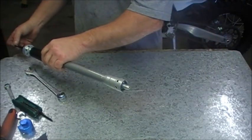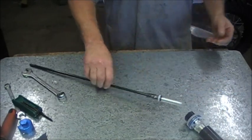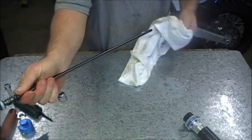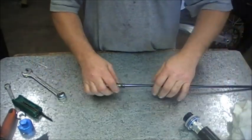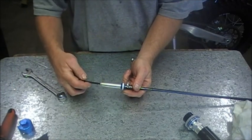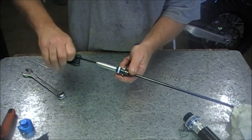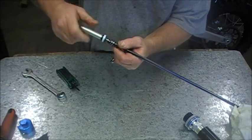It's just a case of removing the cartridge piston. This is the part we want to remove. We do that with a 14mm spanner on the rebound tap. Be gentle with this — it should break easy. It's a very, very fine thread. And you also want to make sure that none of the washers or shims are stuck to the bottom of this as you take it off.